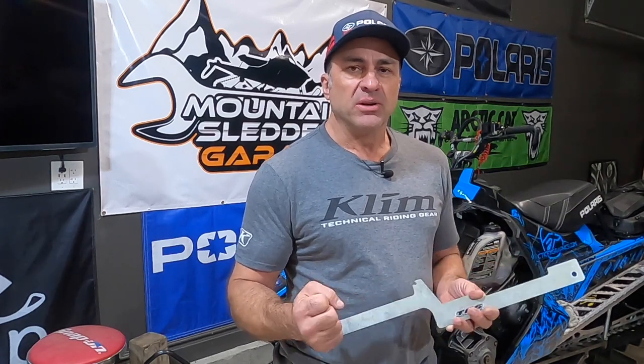Videos coming up. The next one we're going to do is the alignment bar video. Perfect clutch alignment will help your belt last longer. It'll help it not generate as much heat and just help your belts and your clutches perform to the maximum potential and not lose power through your CVT system in belt heat and belt wear. So look for that video coming up. We're also going to do some other videos on Polaris clutch maintenance as we go through this Polaris clutch maintenance video series. So look for those coming up.